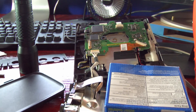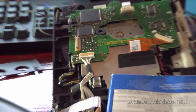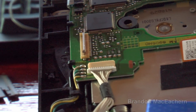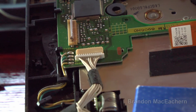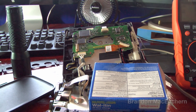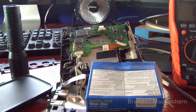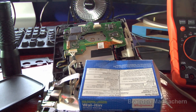Okay, here's where we stand. I have this Wii taken apart, and I've diagnosed that the optical drive is a problem — this drive has no life in it whatsoever. However, there is power making it to the power connector, so it's not an issue with power delivery at all. The optical drive is completely dead and will need to be replaced. I'm wondering if the lockout was caused by bad bus activity from the faulty drive, which was preventing the machine from booting.